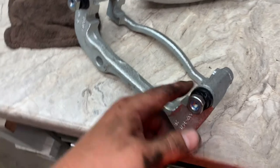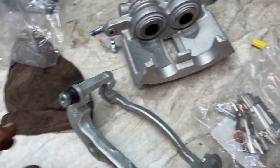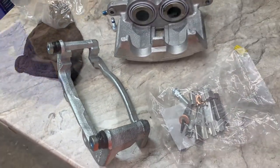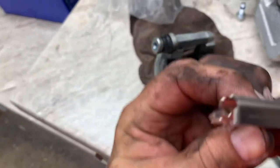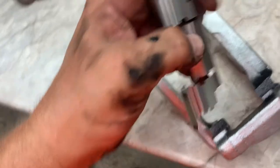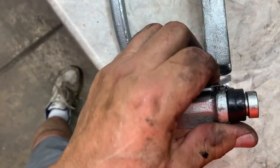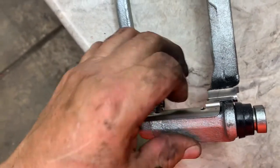I like to paint the bracket. Then put your abutment clips on — make sure you put your clip inside for the caliper; it pushes on the pads. Put your abutment clips in there — see how that one has a little tab sticking up? Let them go up inside. Make sure you push them in to bottom them out — push them in first, line it up, center the center piece and push that in first, then go and do the sides, and make sure they're bottomed out.